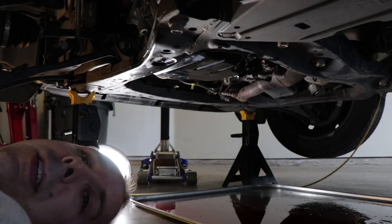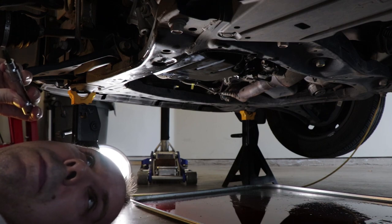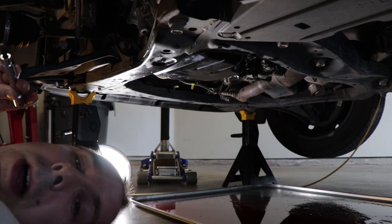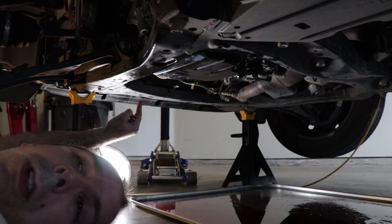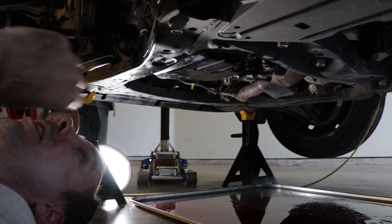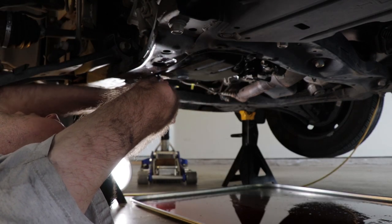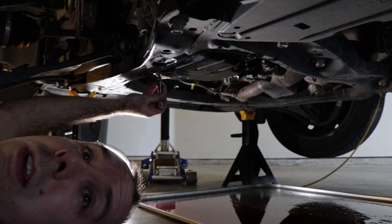So the torque spec on this is 7 inch-pounds, which is so small that any of the torque wrenches I have wouldn't be able to measure it. But what it seems to be is that just means that it needs to be all the way in and bottomed out in the hole. This is not a totally blind hole. It looks like there's a little ridge in there that this rests on. So we need to get this in there and bottomed out in the hole. And as you can see, it fits on our 6mm hex bit. So we go ahead and stick him up in there like this. Turn it in. As tight as I can get that with my hands. It's tight enough for that purpose.